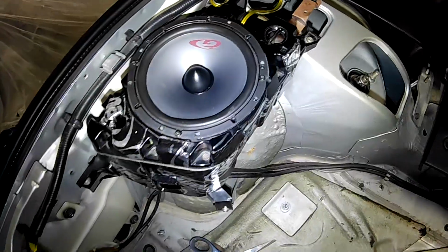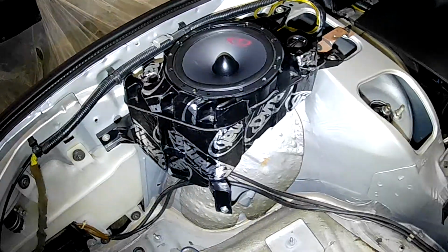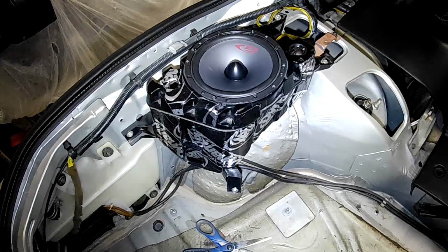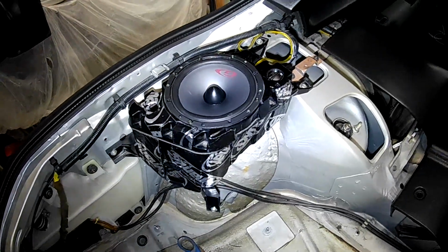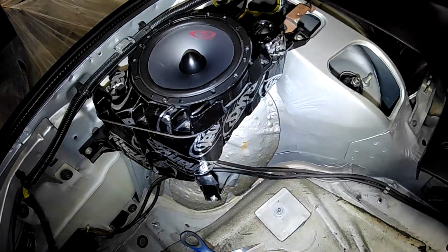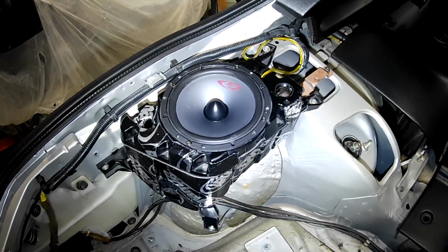It worked out really well. I actually tested these boxes earlier on when I was testing these speakers out, and that's what led me to putting the Dynamat on them. Even turning the volume up slightly, the plastic just started to resonate really badly. So I thought, oh God, I knew I had some Dynamat sitting around here somewhere. I'm going to hit them with some Dynamat. So they're a lot deader now. Obviously you can't tell without a comparison, but it's quite dead now. Anyhow, just thought I'd touch briefly on that. It's something I whizzed past and didn't even mention.